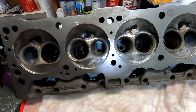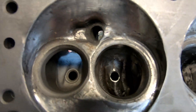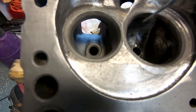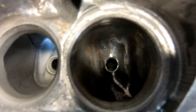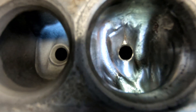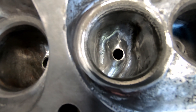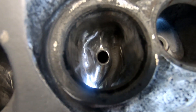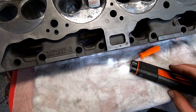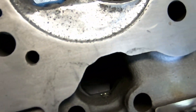I think I'm calling my intakes done. I think they're all pretty uniform. Basically, I tried to set my little tail up there to match the opposite side, and I just brought the guide way on down because it was huge. Good old cast iron starting to rust already. I'm sure y'all can let me know how I did in the comments. I think it's going to flow a lot better than it was. You can still see my very faint marks here where I had marked earlier for my throats, so I didn't take any of those out too big.